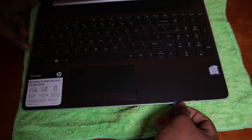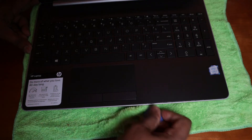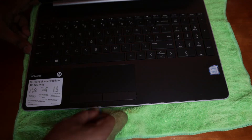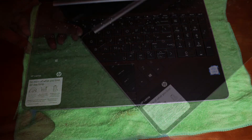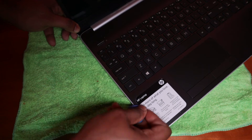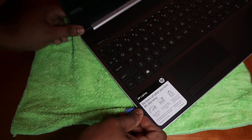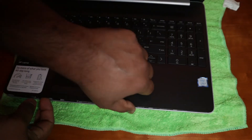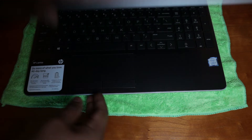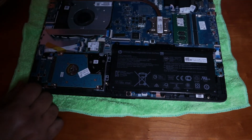The cover has a lot of plastic locking clips inside, so you can hear small cracking sounds — that's just the plastic knobs opening. Work all the way around it, don't rush. If you put too much pressure it will break. Just work through it gently and lift it off.